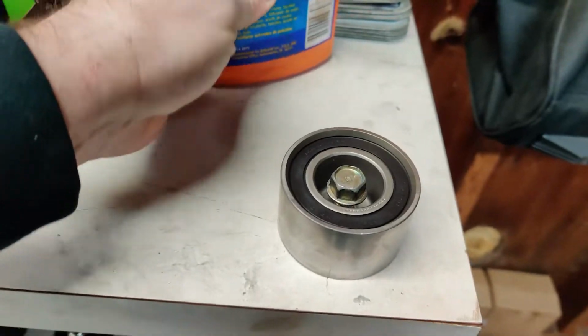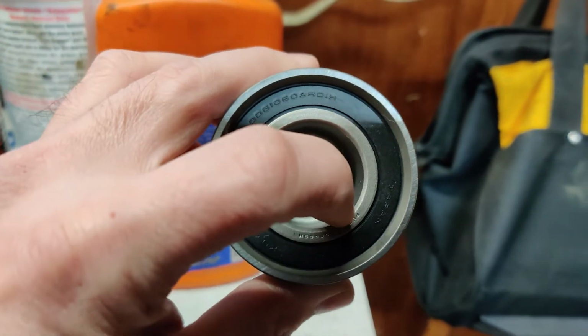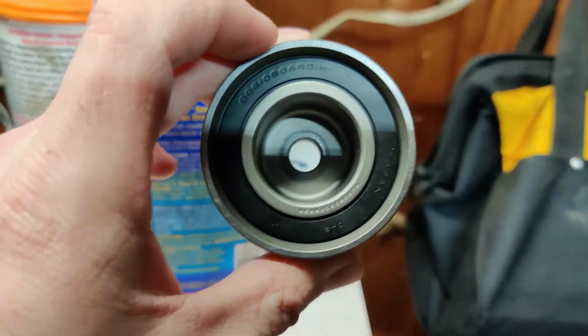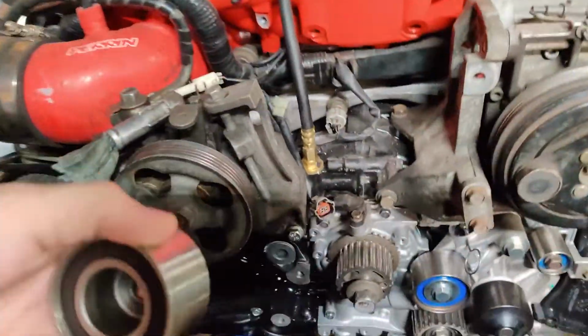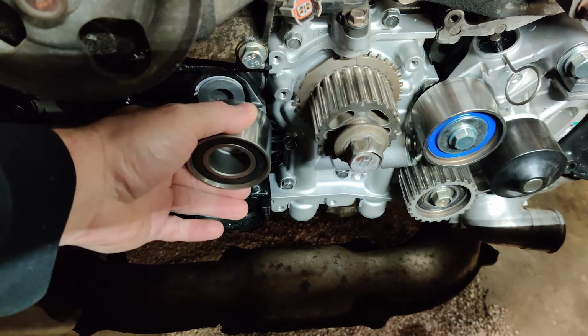So what I did is I went ahead and ordered some IAG adjustable idler pulleys. I'll have a link in the description down below. Pretty much what they do is they're offset pulleys. So here is our original pulley. The ones that we ordered, the hole is offset, so we can get this closer or farther away down here. So say it's right here, we can adjust our little bolt and move it this way or that way. So we can put some tension on the belt with those pulleys, and we should be able to adjust the cam gear and the timing. That should be here Friday, so hopefully by the weekend I can get it back running again.